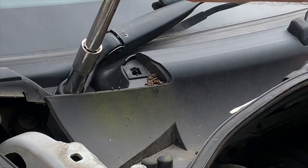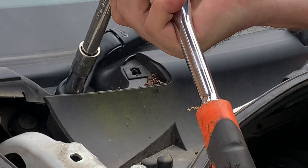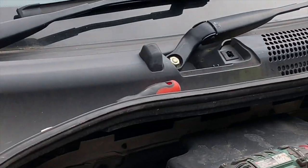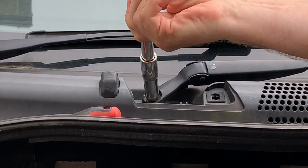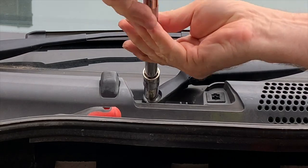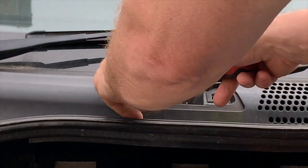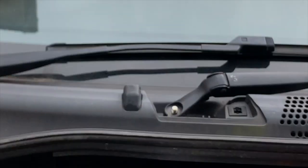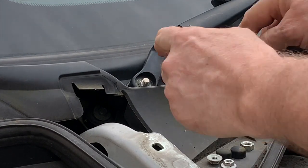A 13mm socket on there. Once it goes you can do it by finger. Keep that safe and move on to the other one. They're always on reasonably tight but they're easy to get off. Now there should be a washer there - use the same screwdriver to ease that washer up, because if you just pull up on the windscreen wiper these will flick off and you'll never find them again. So it's better if you can actually get them off yourself first - that way they won't get lost.